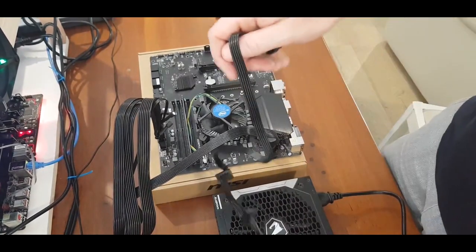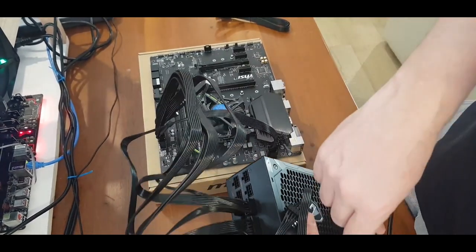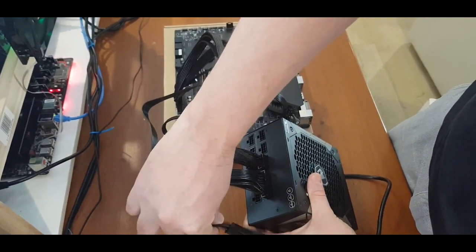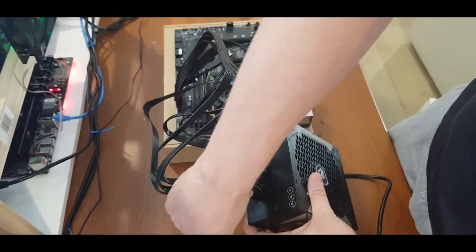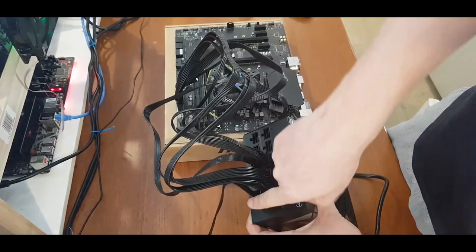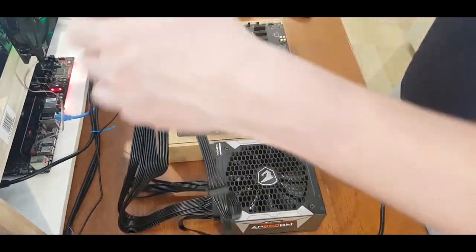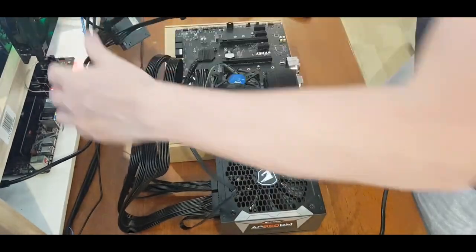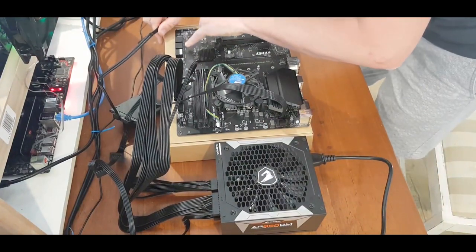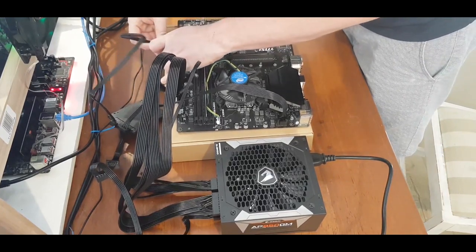What we'll do now is come here, get our PSU, and underneath the 24-pin connectors for the motherboard, there's a 6-pin peripheral connector. That's plugged into there, so that's good, clicked in. Then we'll take the SSD for little walkies and drop this. There's SATA 5-6, SATA 3-4, SATA 1-2. I'm just going to put it into SATA 1, the bottom slot here.